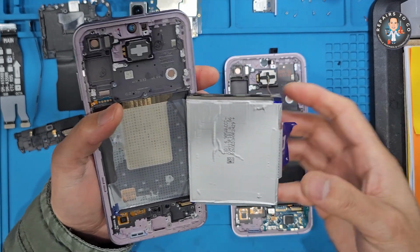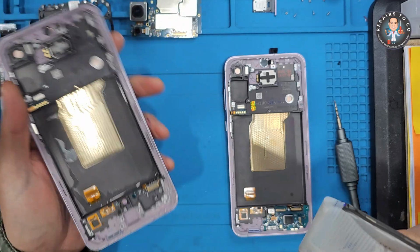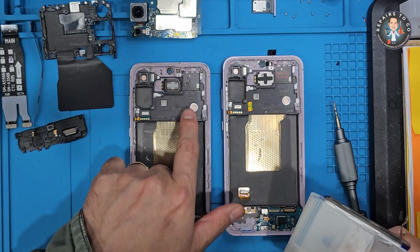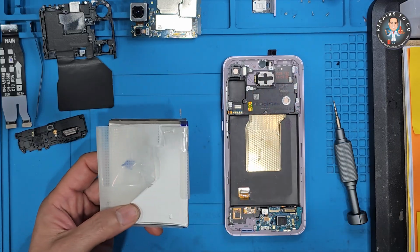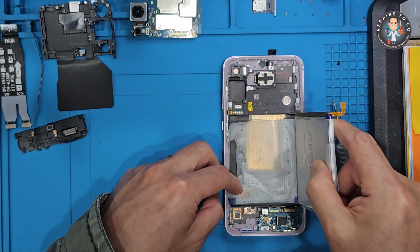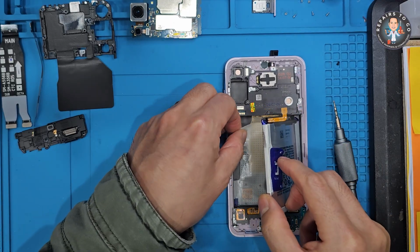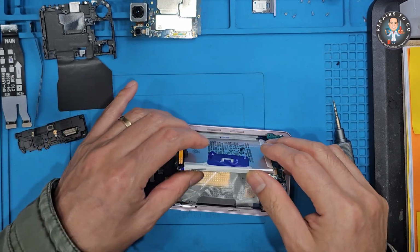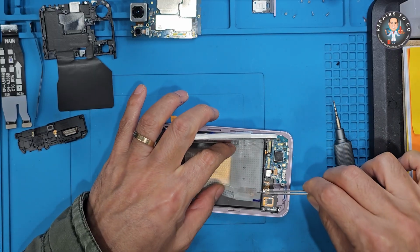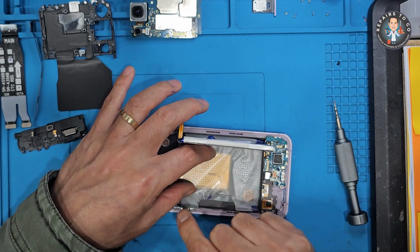Reduces error. Since most small components come pre-installed or in proper placement molds, the chance of misalignment or accidental damage during installation is lower. Saves time. Compared to glass-only replacements that require special tools, OCA adhesive, and curing, full assembly replacement is faster, ideal for busy shops or time-sensitive repairs. Better structural integrity. Replacing the frame as well ensures the device regains structural strength if the original was bent, cracked, or deformed during impact.